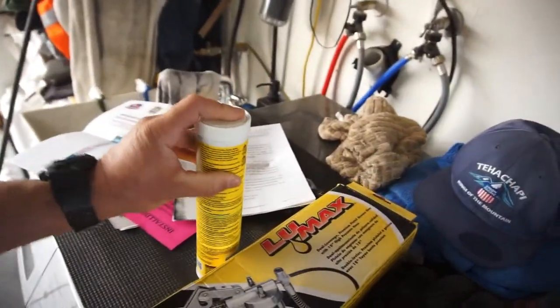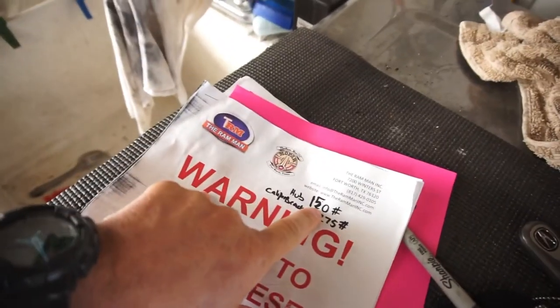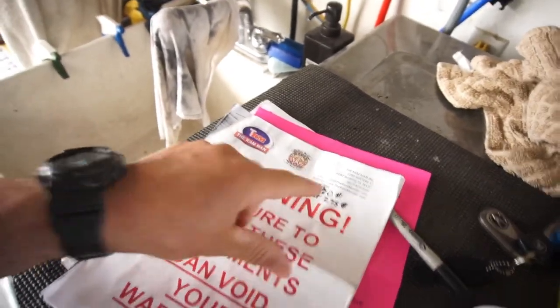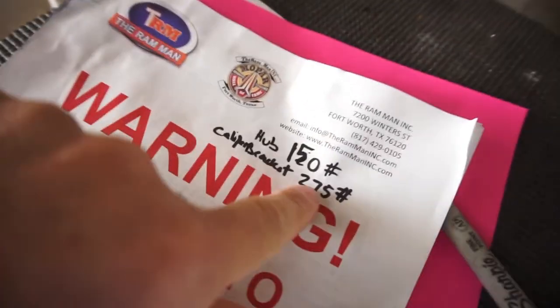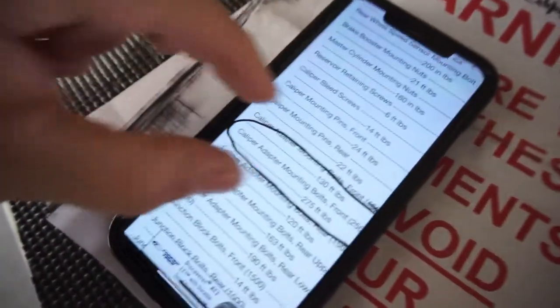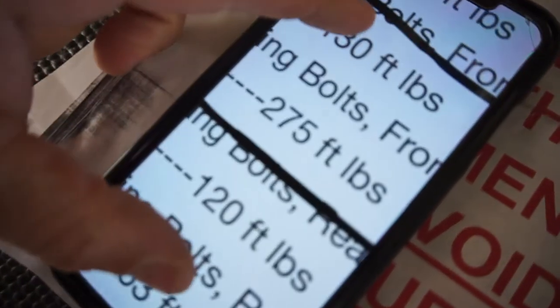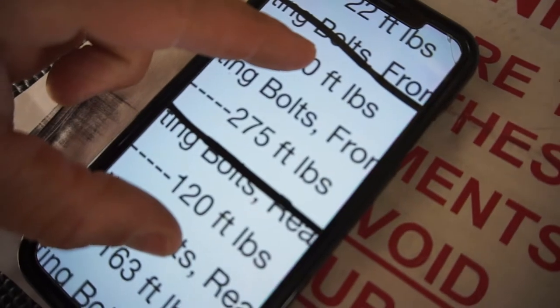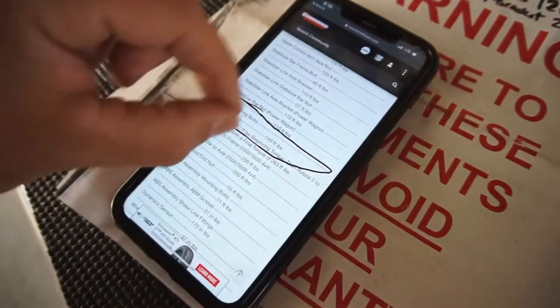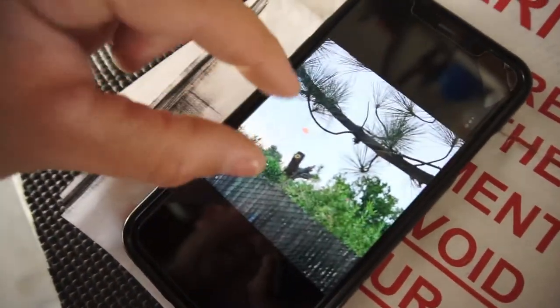That's why I got this, along with a new grease gun. I did get the torque specs: the four bolts that hold the wheel bearing in get torqued to 150 foot-pounds. And the caliper bracket bolts - believe it or not, not even lying - 275 foot-pounds. I took a picture just in case. Front 2500/3500 caliper adapter mounting bolts: 275 foot-pounds. Hub/wheel bearings: 149 foot-pounds.